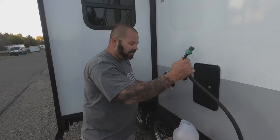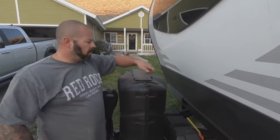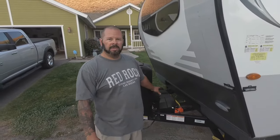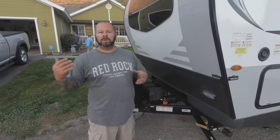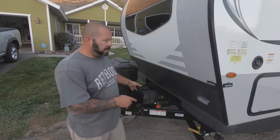There are two more things I'm not doing on camera but I'll show you up front. I'm going to close both propane tanks, and I'm also going to remove both batteries and put them in the garage on a maintainer all winter long. The reason is the very first year I had my last camper I didn't remove the batteries and had to replace both after winter because cold actually damages battery cells. By putting them in the garage on a maintainer, your expensive batteries will still last years.